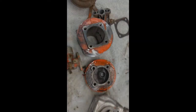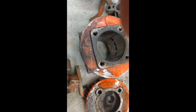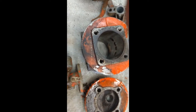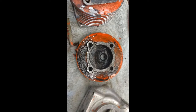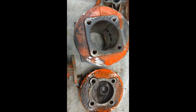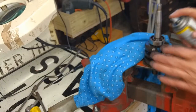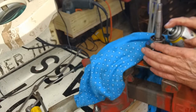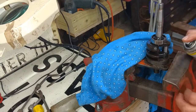I've been cleaning up some of the parts here and found another problem. Notice this side - all the black on this side, and look at the head - all the black on this side. Looks like we had a leaky head gasket going on. Now the reason to tear down... onward and upward. I've cleaned the bearings already and now I'm putting some penetrating oil on them.